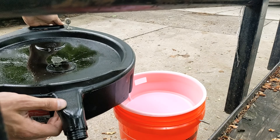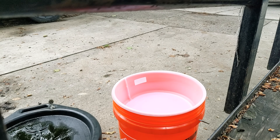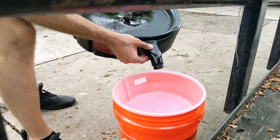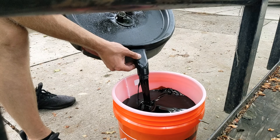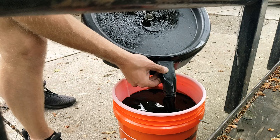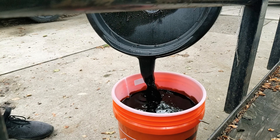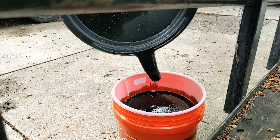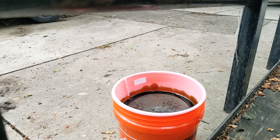So now we're going to get into the good stuff. I've taken this oil from my car — it's still fairly warm, keep in mind. I'm going to pour that right into the bucket. You can see what I run — 15-40 — pretty happy with that, especially the service life. Hot oil right into the screen, and that will pick up any particles larger than 100 microns. Given the tolerances on this cheap engine, I don't think anything smaller than 100 microns is going to cause an issue. Do this at your own risk — I wouldn't necessarily say I recommend this, but if you're trying to tinker around and create some more problems for yourself, I'm all in. Screen the oil, and then off to the motor.